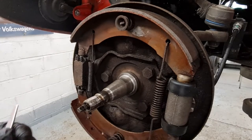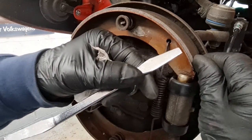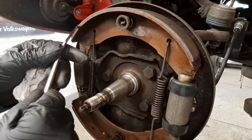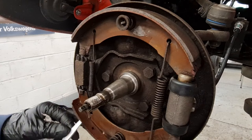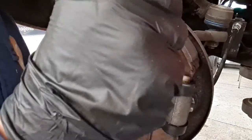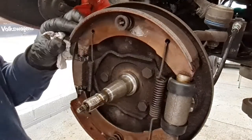Now that we've cleaned down our brake shoes, I'll start the inspection. The first thing I look at is the actual friction material on the brake shoes themselves — making sure it's not delaminating off the body of the shoe, and that the material is even all the way around. I've got a lovely even thickness there and we've still got plenty of material left, same on the bottom. Our shoes are working evenly. Next I check the lining contact. Looking at the top, the friction lining is touching the whole of the brake drum, so we've got good frictional contact, and that's on both shoes.